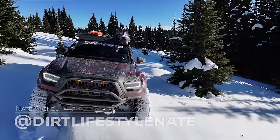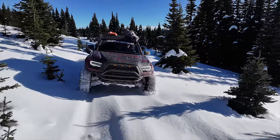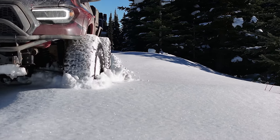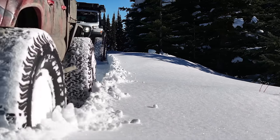We're able to do this for a couple of different reasons. One, we've got nice big tires. Two, they're aired down super, super low. If you look at all the different little snow creatures that live in these places, they always have these crazy huge feet so they don't post-hole and sink down and get stuck. We don't have to worry about getting eaten, but we definitely need to worry about post-holing — our tires sinking and getting hung up on the frame and diffs. So because we're aired down and have that large contact patch, it gives us the ability to stay on top.